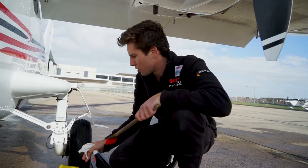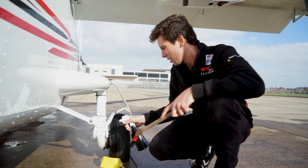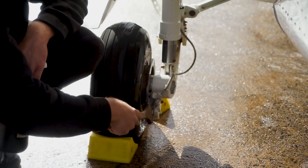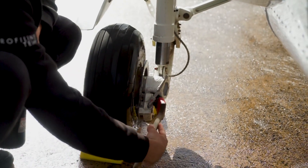After letting the Multistar sit, we agitate it with a brush and then rinse it all off so the dirt comes out nicely. We want to pay attention not to wash out too much of the grease, because that's there for a reason. We use the brush to agitate and loosen the dirt all over, and then after that we'll hose it off.